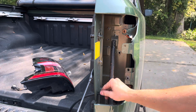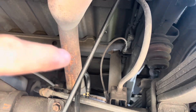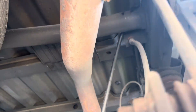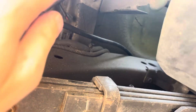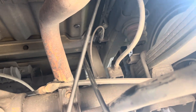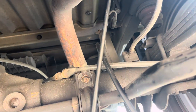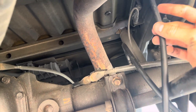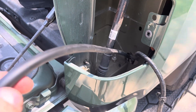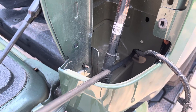I put some of the extra hose through this hole so it won't fall back down and I won't have to re-route it from the bottom. I have the hose routed how I'd like it and I'm just going to pull all the extra out through that taillight hole. One thing I want to note: if you look at all the stuff connected to this rear axle, it has some slack — that's so the axle can flex. I'm going to leave some extra hose there so it's not pulling tight when the suspension droops. I'm going to zip tie it to the brake line so it won't interfere with the exhaust and melt.